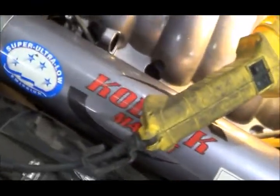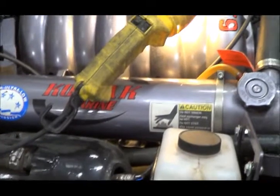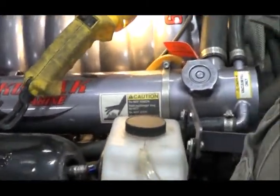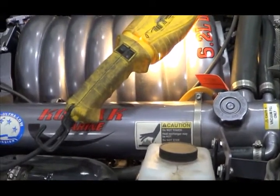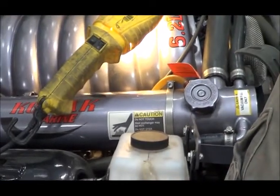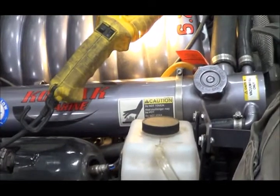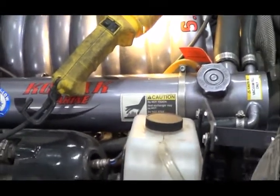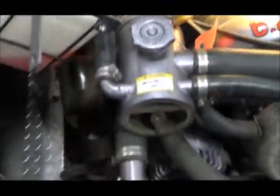There's another interesting implication of a three-pass design: it will be less effective at cooling the engine. You want the river water to be as cold as possible for maximum cooling, and the way to do that is to have maximum flow through there. Three passes defeats part of that purpose. It's like having three garden hoses side by side versus one hose three times as long — the single long hose will have much less flow. So the river water heats up more and becomes less effective at cooling the antifreeze. This design works when the tubes are unobstructed, but it could be better.